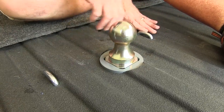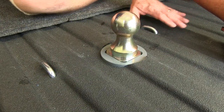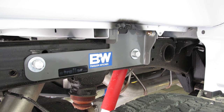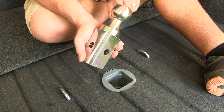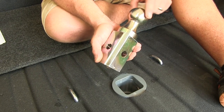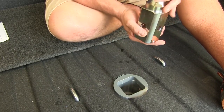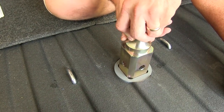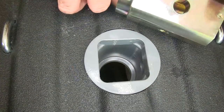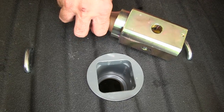It's going to be a complete under-mount system. You're not going to be required to remove your bed or do any welding — it's simply going to slide in between by cutting a notch on the channel on the side of the bed, sliding our braces in, standing them upright, and attaching our center section. Since our ball has a square base, if it was ever to become locked up inside the gooseneck hitch, it's not going to rotate around because it's attached in a square form. It's drilled on both sides so you can put it in either way, and it has a large 5/8ths diameter pin that locks it into place.